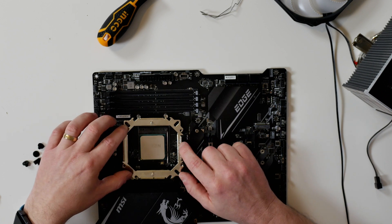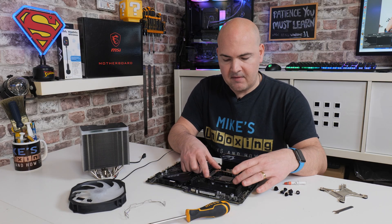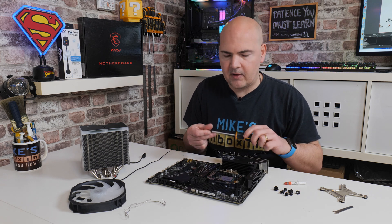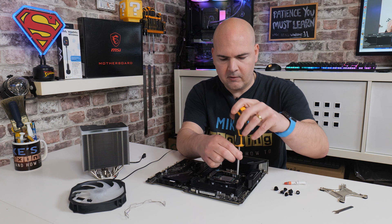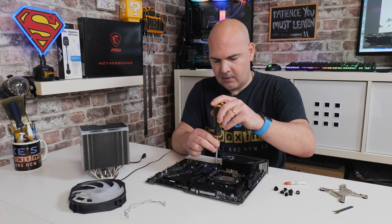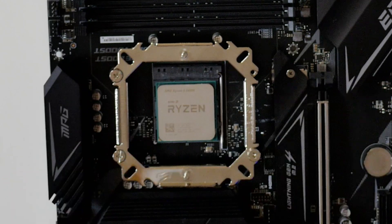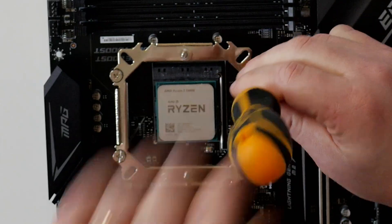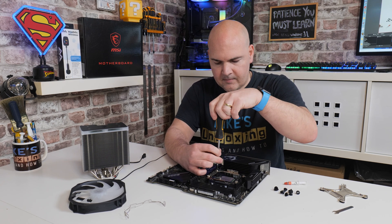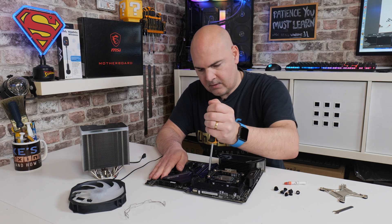You may find that the top plate doesn't always fit down exactly over all of the pins — that isn't too much of a problem. Ideally you would like it to fit down snugly the first time, but there may be a little wobble. When you tighten up the four screws on top, you'll find that will push it down. This is down to the very slight tolerances in the AM4 backplates. Put in one screw lightly first, then you're going to be screwing all four screws right down to the very bottom. On this particular board, this corner is sitting slightly proud, so we're going to add a little bit of extra force during the installation just to make sure it's gone down firmly.